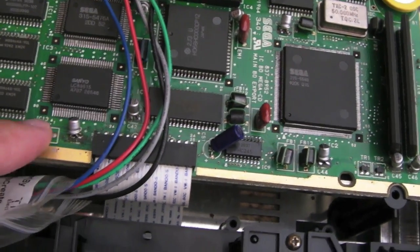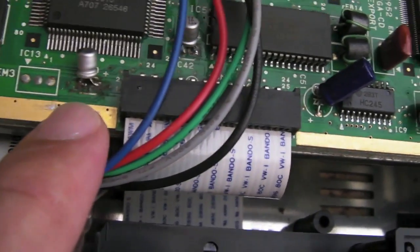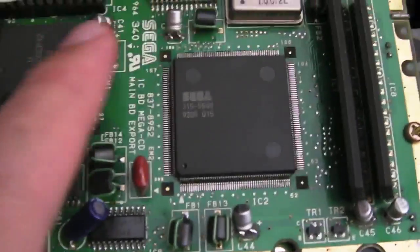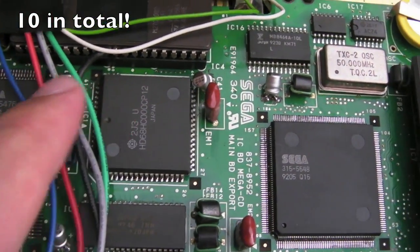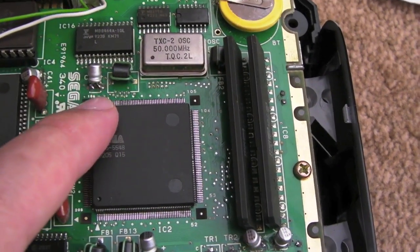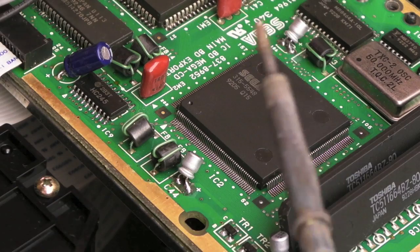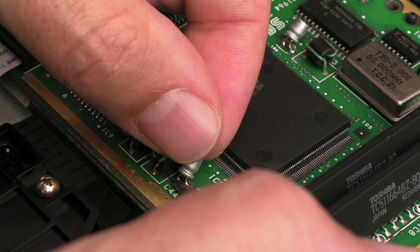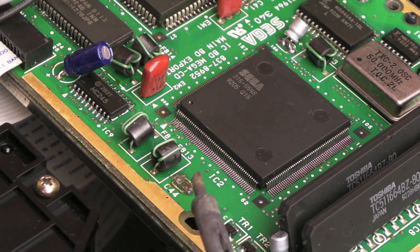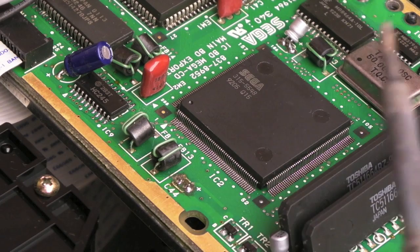Right, the shielding's off. You can see they needed cleaning up because you can't get a cotton ball under there because of the way these were mounted — it looks awful. I'll be gently heating and removing each of these SMD caps around the board; there are about 12 to 14 of them. Some will be fiddly to get to because of wires. I don't need to take the board out — I'll just carefully remove them, solder the new ones back on, and wipe around with cotton buds and IPA.